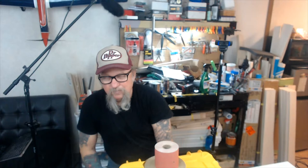And you say, well, what do you mean you don't paint them? You just let the overspray from the spray gun land in the fillet, and that's plenty. I'll guarantee you, if you put a wet coat down a fillet, within a week it'll be lifted out. And it's real simple to explain. The fillet goes around a corner like this. You lay in a wet coat of paint, and as it dries, it shrinks and stretches. Instead of laying down in here, it's stretching out like that, and you got a pulled up fillet. So don't paint fillets. I use the Superfill and leave some tooth on it.